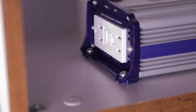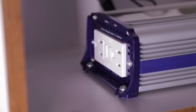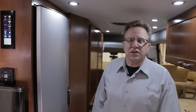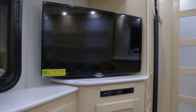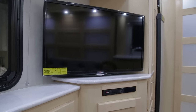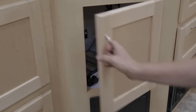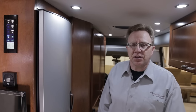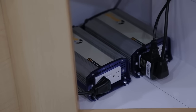The Plateau XL differs in that it features a 32-inch TV in mid-cabin rather than the rear corner, with inverters located directly below the TV on the shelf. If you have both interior and exterior TVs, you will find two inverters. There are only three plugs as the outside DVD player is a 12-volt unit.